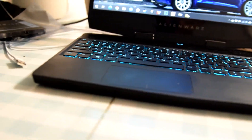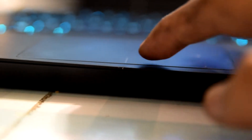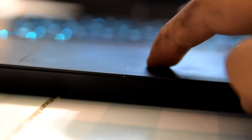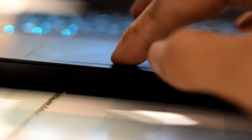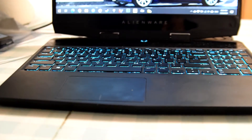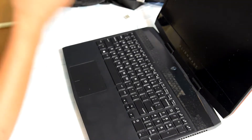Now that the computer has been running for a bit, you can start to see the problem. If you zoom in, the touchpad is starting to bow out in the center. You can see where it should be versus where it is now. The effort to press it is going to get increasingly more difficult — sometimes when I used it long enough, I basically couldn't force myself to click it. That's the telltale sign you might have the same problem.